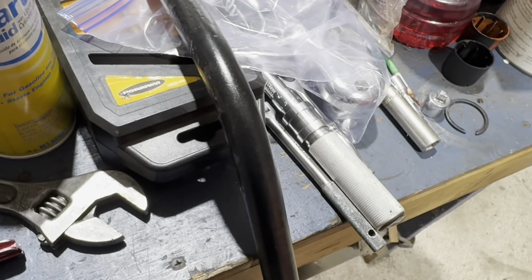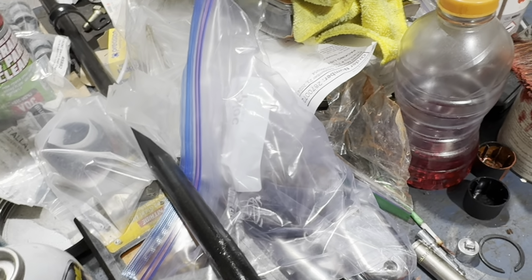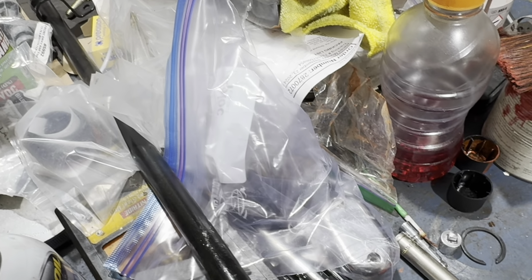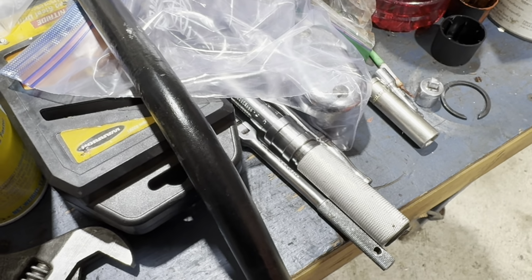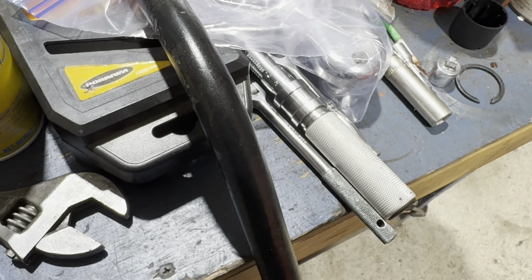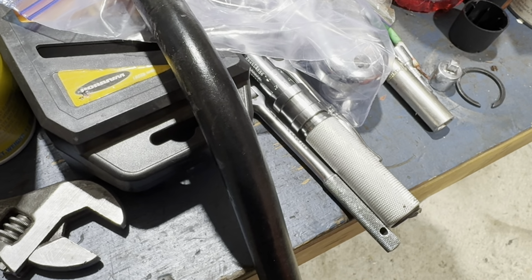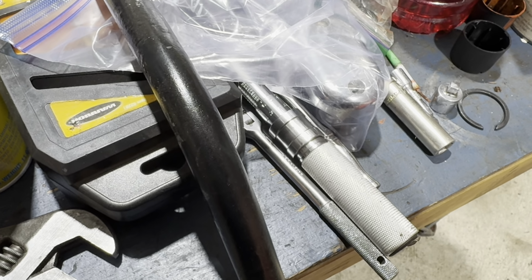The other problem is the sway bar diameter. A lot of people don't know this, but there's actually 3 different sway bar sizes on an E-body. I think it's 3, maybe it's 2. I know it's 3 on B-body. I'm pretty sure it's 3 on the E-body too. Keep in mind, I'm giving you metric measurements just because I was looking this up on Rock Auto. I don't know what the translation is, but according to them, they have 22, 23, and 24 sizes for the bushings, for the 3 sizes.